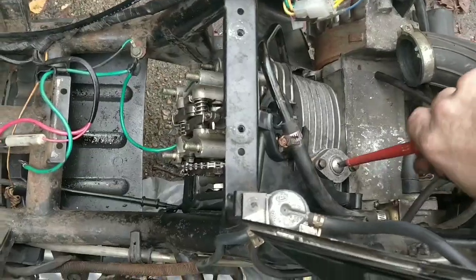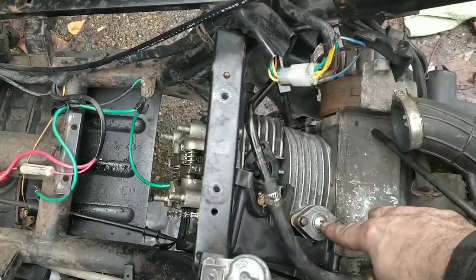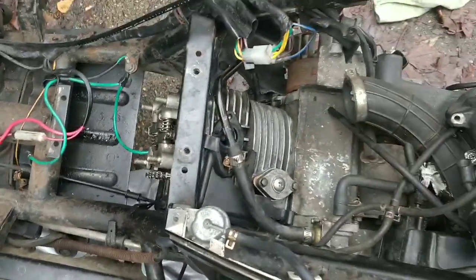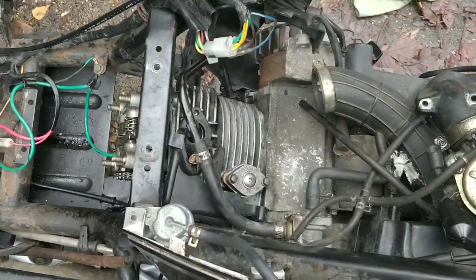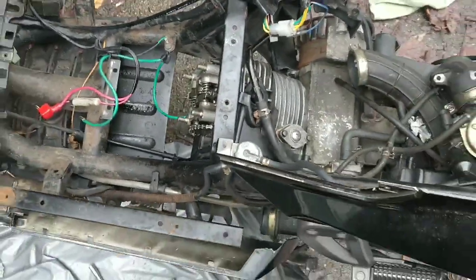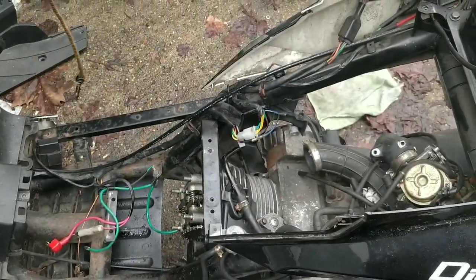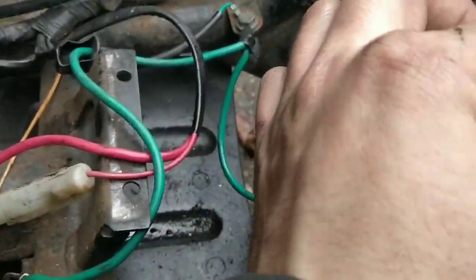So there's your system. What is worth noting there, guys, if you're doing this yourself, is wait to hear the click, okay? Wait and hear the click. If you don't hear a click, then it hasn't gone down, and if you run it like that, you could be screwed. So wait and hear the click, and then help it out. Use it like I just did. Put the little screwdriver in, wait for it, and you'll hear it click, and then you're in a better position than if it doesn't click, because it's bound to skip a tooth. So there you go. So that chain is tensioned.